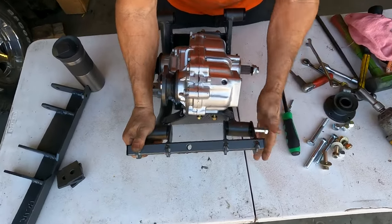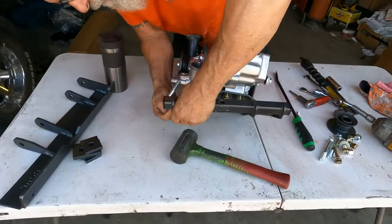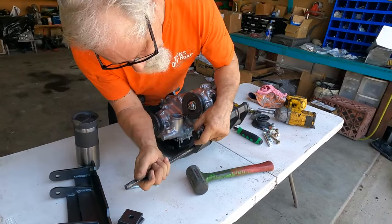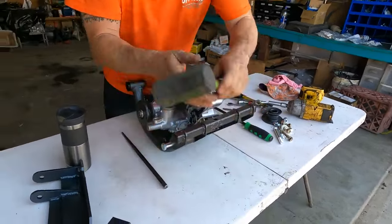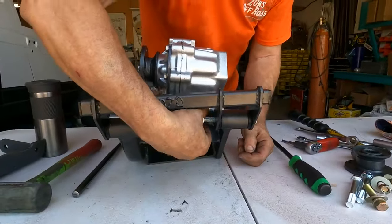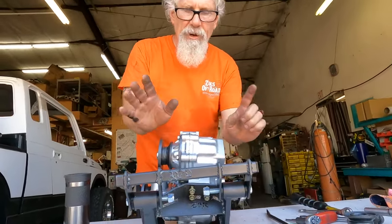I like to start the bolts from the outside in, and typically it's very common to hammer them in. We're using Nylocks. When you tighten this, please just touch the steel. Do not crimp the bushings. Let the bushings work. So just tighten these, and if you have a little air gap, that's fine.